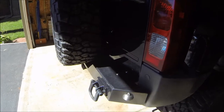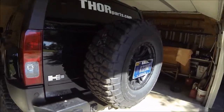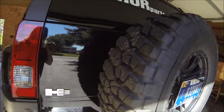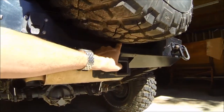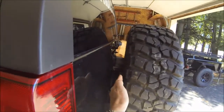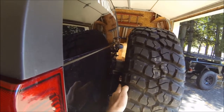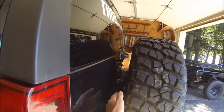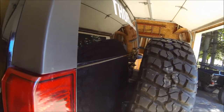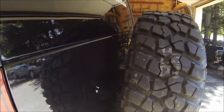This is a stock H3 with the Thor Parts rear bumper — there's no body lift or anything on here — so this is exactly where the bumper sits. I'm running a 17 by 9 rim and a 35 inch tire, and if I get down here on the bottom you can see I have about a half inch of clearance right here. In addition to that tight spot, notice the wheel is offset for the Rancho kit — this is a minus 11 millimeter offset — and it pulls it away from the door more than I would like, so in addition to raising the spare up, I also might want to pull it back into the door about another inch and a half.